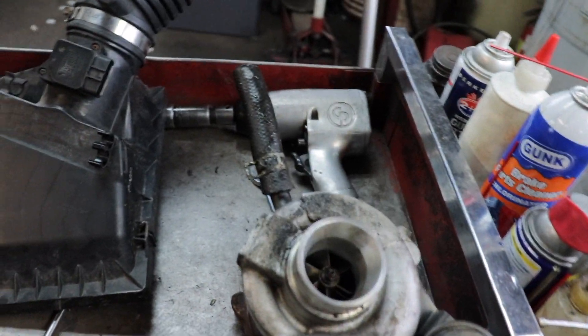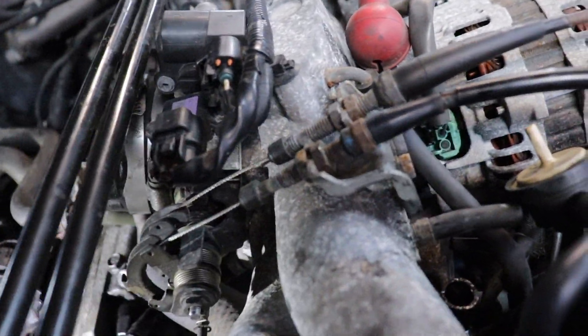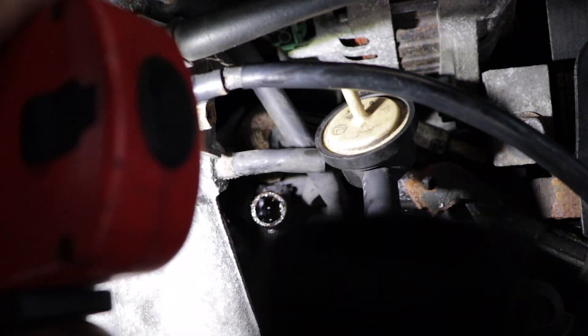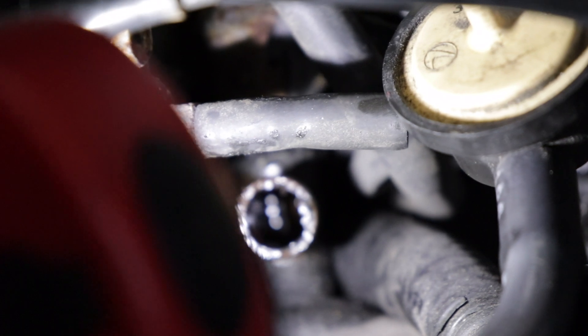I think I'm actually having an issue with the engine. The turbo got pulled off and I don't visually see anything wrong with it. The other thing I was kind of ignoring before is the fitting that accepts the PCV system - you can see how much oil is in there. It's quite a bit of oil, and this is before the turbo and before the blow-off valve. I'm really not thinking it's the turbo. The only way to really tell is to take this turbo apart and see if the seals are ruptured. I might just do that to double check - the only thing I can do besides pulling this engine apart is just swapping turbos.